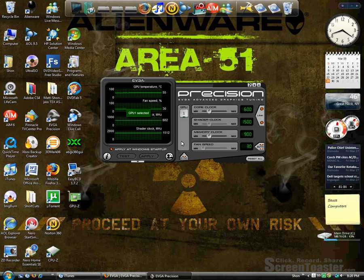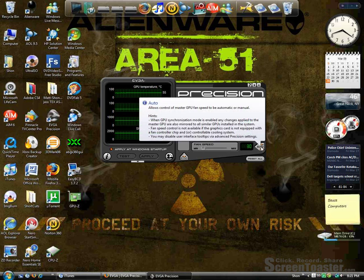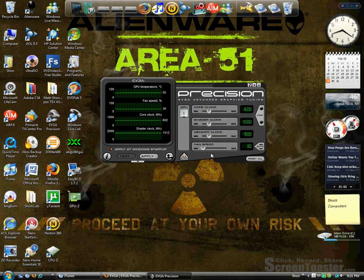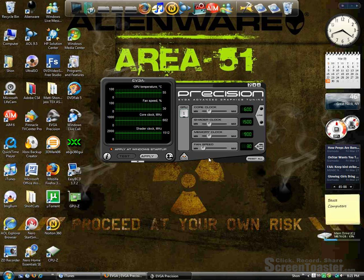Make sure it's on your one GPU, unless you're using SLI — then do the first one, then the second one. Start with turning off auto for your fan speed and turning off the link. Just to let you guys know, do not follow the fan speed exactly — it's going to be different depending on wherever your rig is and however your room temperature is. You have to toy around with this a little bit.